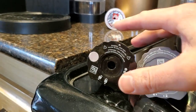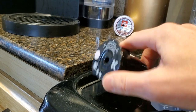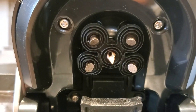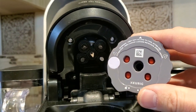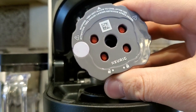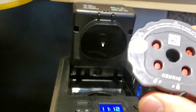This is the new design, and this is the old design. The old design will fit into virtually every machine because of the way it's designed and because it's got a single hole, but that's the reason that it won't fit on the Keurig K-Supreme or the K-Supreme Plus, because it needs five holes. That's why they came out with this new design. This will fit up there — those little red gaskets will open up when you close it down, and water will flow through all five holes. This Universal Fit will also fit in all the old styles because it's got the single hole in the middle.